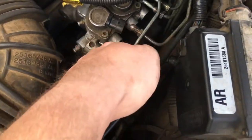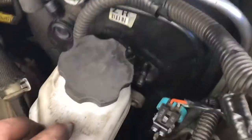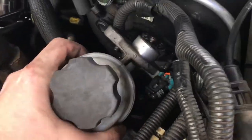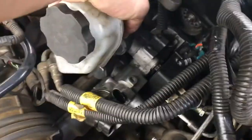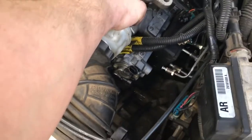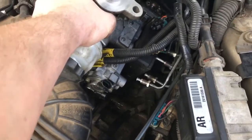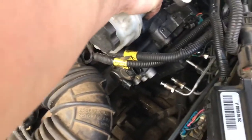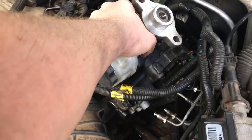We're back. I got all these lines off and I've already pulled the master cylinder off of those rods. What we're going to do is turn it — you kind of have to finagle it out of there — turn it sideways. I'm going to have to do this with both hands. Be careful not to mess with the fuel lines too much and just pull it out.